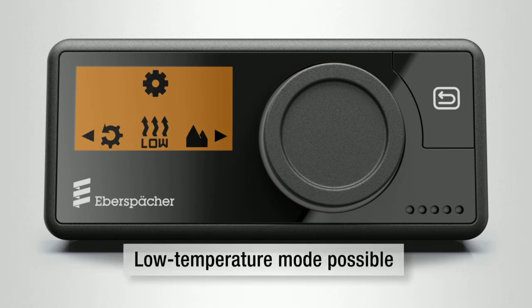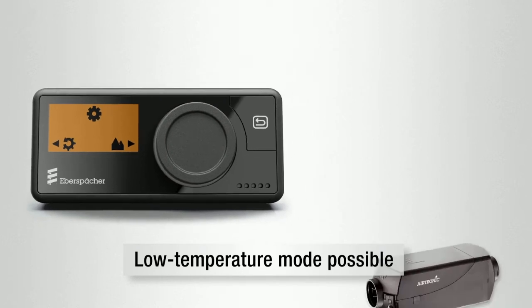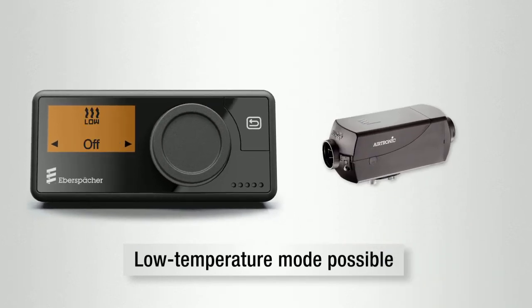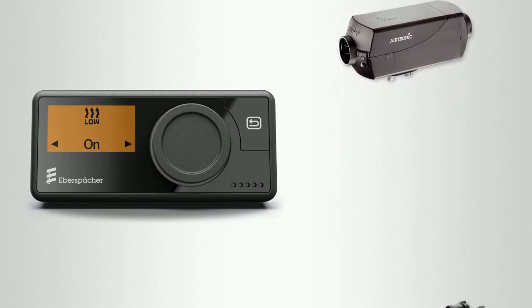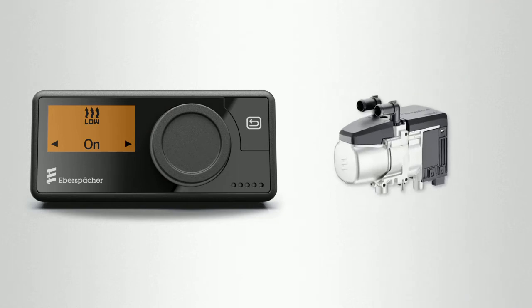EasyStart Pro also offers a low temperature mode. If you use an Airtronic heater, the outlet temperature is lowered in low temperature mode. For example, if the air outlets are positioned near the body. If a Hydronic is used, the low temperature mode allows more uniform operation when outdoor temperatures are mild.